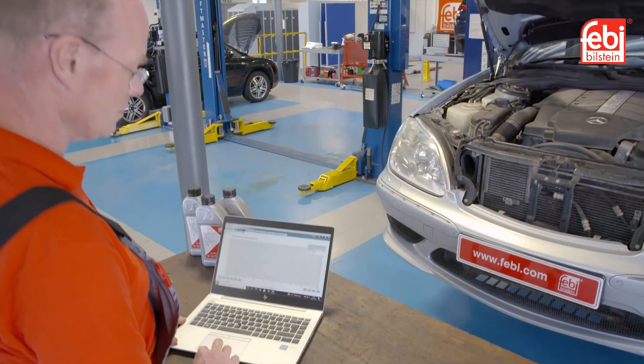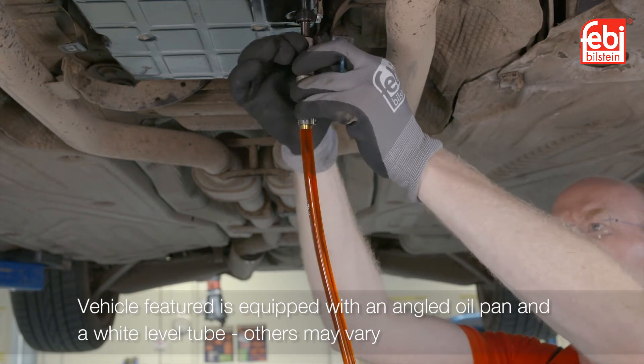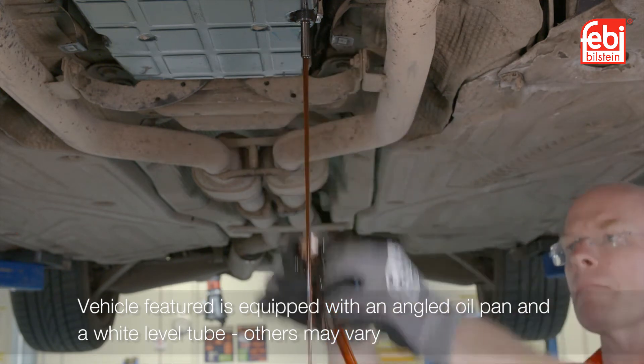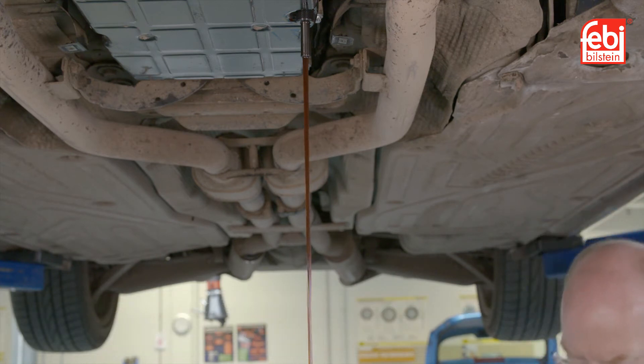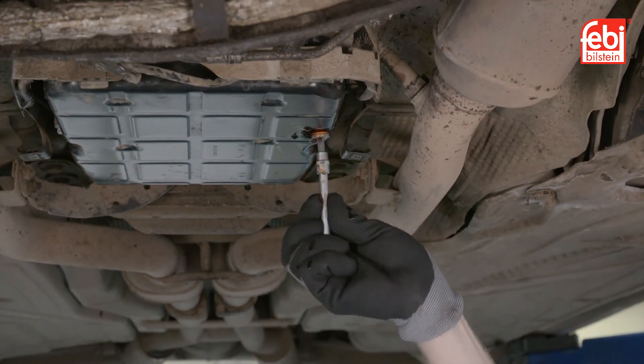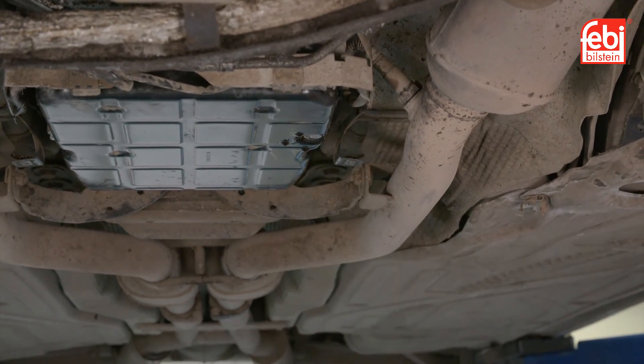When the oil has reached the specified temperature of 45 degrees Celsius, remove the oil filling tool and allow the excess transmission oil to drain and reduce to a drip. Fit the new oil drain plug. If no fluid loss is apparent, top up as required.